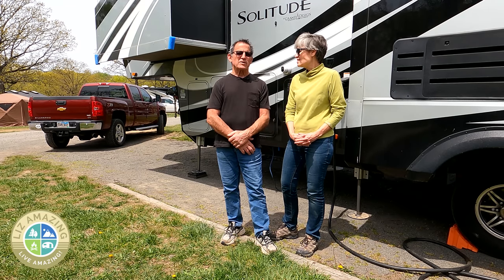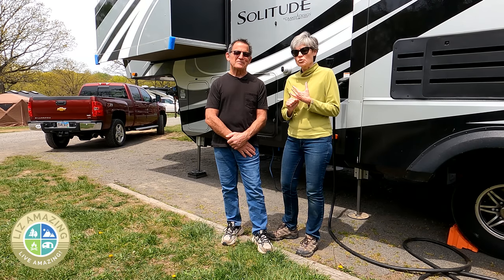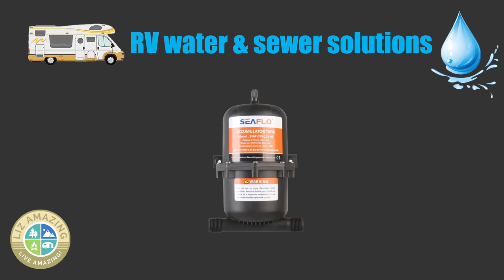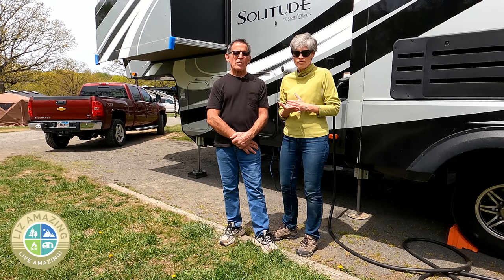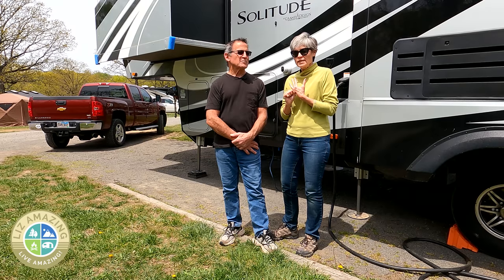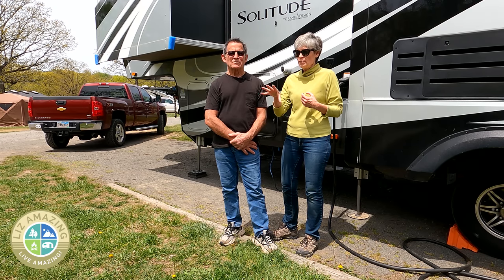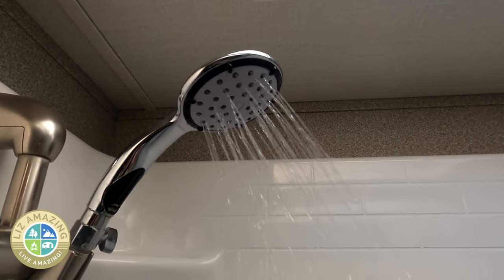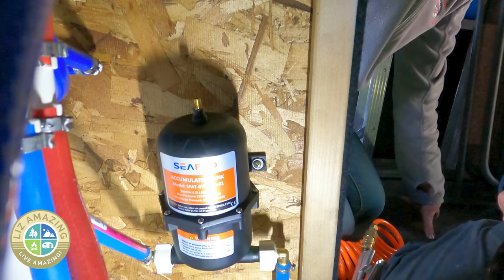The macerator does require a 20-amp circuit, so you'll need to run a dedicated circuit for it. We'll put a link to the macerator pump in the description and in our Amazon store, and we also have a special macerator pump installation video. Now, the accumulator — I had never heard of such a thing. It's stereotypical of RV life to not get enough water flow when you're in the shower. One of the secrets to getting more pressure is to switch over to your pump even when hooked up to water, but then the pump pulses, and this is what the accumulator smooths out.